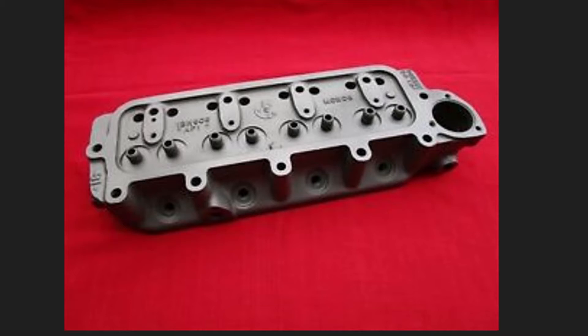He specifically identified the model type of head that you cannot put on older engine blocks. If the block doesn't have that relief, you'll have problems with the exhaust because of the depth of the combustion chamber. I'm fairly certain this is a non-interference head - meaning the valves don't protrude and interfere with the pistons - but it does have a relief cutaway in the engine block for the exhaust valve.